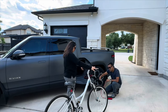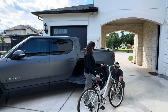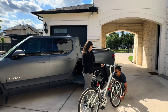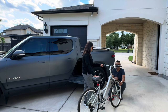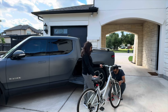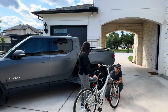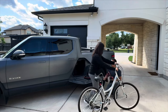Next up, a bike tire that's a little flat. On a bike, we've got this screw-on stem, so we don't even have to add a connector — we can just screw the LastFit right on. While doing that, we select bike mode. This bike says you can fill up to 65 PSI. LastFit's bike mode has a top-end setting of 55, which is pretty good for biking. If you want to go higher, there's a custom option. It hits 55 PSI and stops. You'll lose a little air when you unscrew it, so you want to unscrew pretty quick.